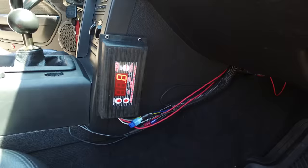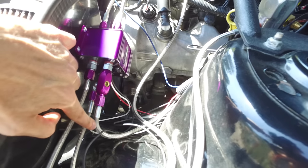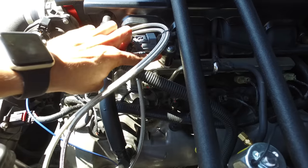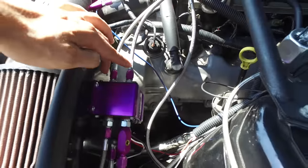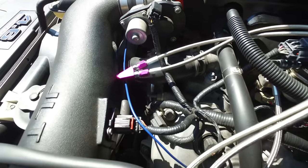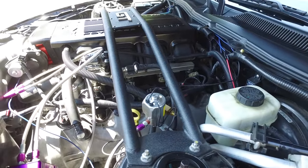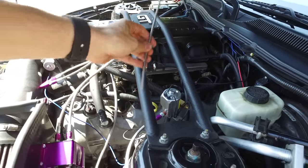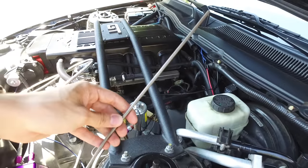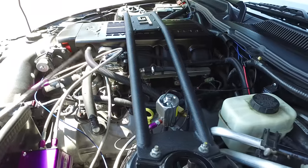Let's go to the engine bay and see what's underneath the hood. You can see we have the main solenoid from Zex right here, all the connections, the nitrous line running in through here, the outlet purge line running through here, and the fuel line which connects to the fuel adapter. From there we have the fuel out and the nitrous out which lead to the nozzle, which currently has the 100 jets. That is the full setup. We also have the dual outlet purge kit right here, but it's not completed because Zex only gave me one foot of line — I'm going to need at least two feet to purge outside the car. I'm currently looking for bendable brake line to do it. So I won't purge today — it will be another video when I finally set up the purge kit, but I just did not want to wait to show you guys the nitrous.